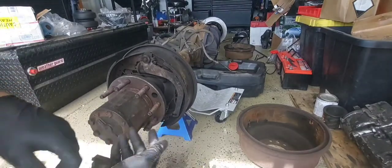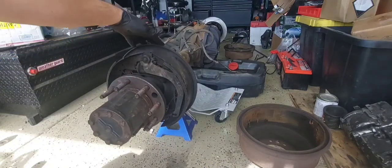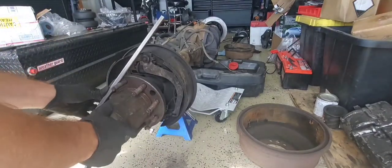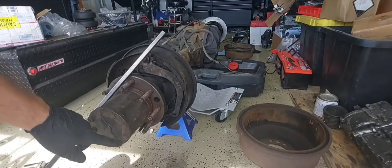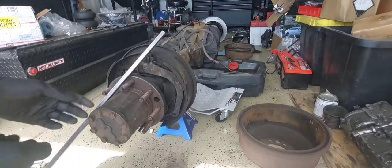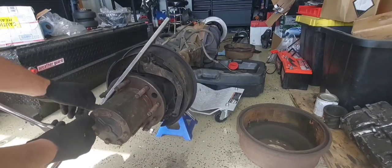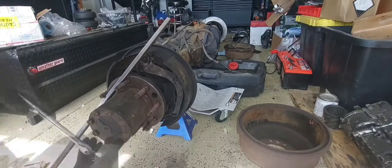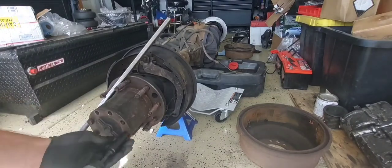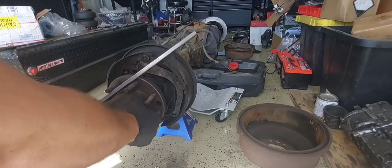Or damage the bearings on the inside. Once that's out, there's four bolts on the back backing plate and the backing plate will slide off. We're using half-inch square tube just to keep this from rotating — you can undo these eight bolts while you still have weight on the truck and pull your axle that way. We just broke them all loose.